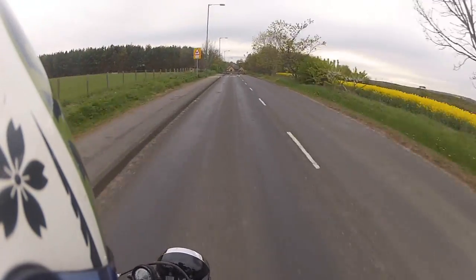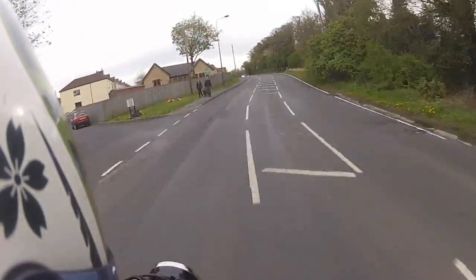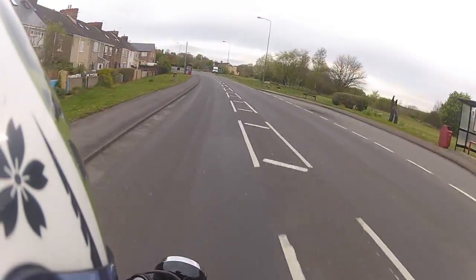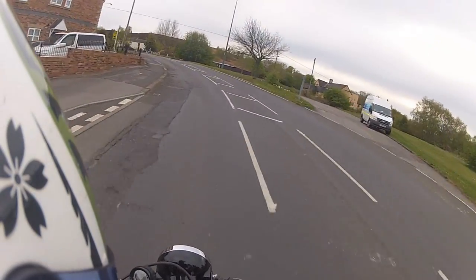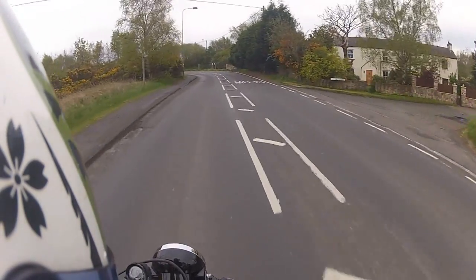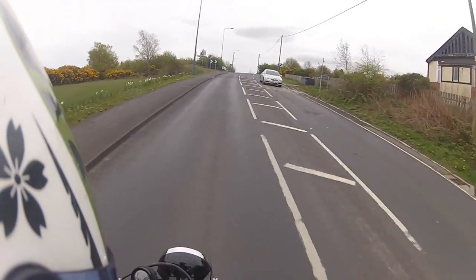The radiator - I fixed the main leak. There was a fracture in one of the tubes and I've JB welded the hell out of it, and it seems to be holding. I've been for a ride and it seems to have held. There's a little seep just under it which I think is actually another leak, but I've got some Rad Weld in - a different make, I think it's Wynn's or something. So I'm hoping that'll just clog that up nicely and fix that little seep. But it's not spewing out like it was before, so that's another great thing.